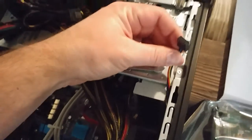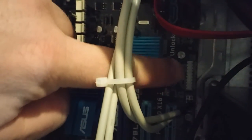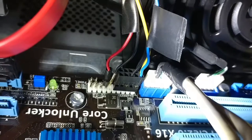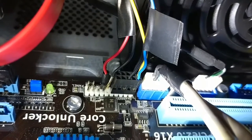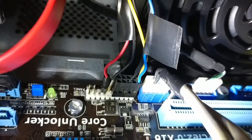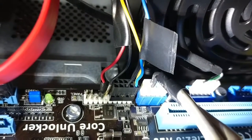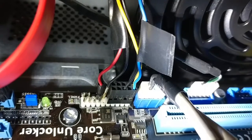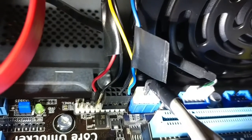I have a little bit of a problem here. The front panel plug that connected perfectly on the old board does not match the front panel plug on the new motherboard. There's my jerry-rigged connections — I had to move the power LED connectors over to some different ports so that I could plug it in. And the power button — the red and black there — I had to completely remove from the old connector and just plug them in directly, and put some electrical tape around that one to keep it from shorting out.